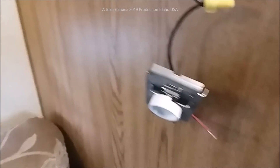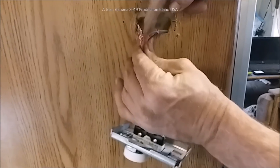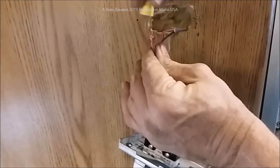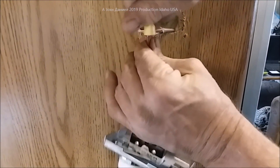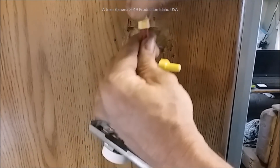I'm going to turn this to cold so it doesn't kick on while I wire it up. I just have a red and black wire going in — red is hot and black is common. When the thermostat connects them together, it passes the hot through. That's how the systems on Suburban and Atwood furnaces work.